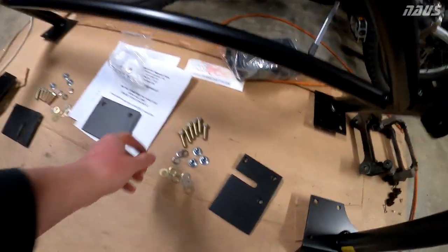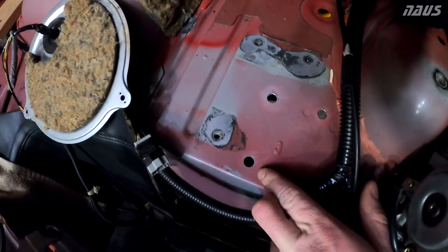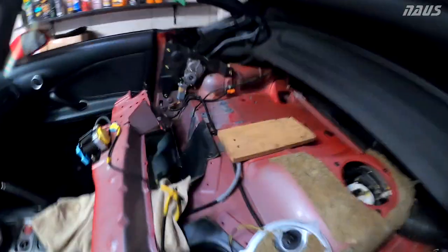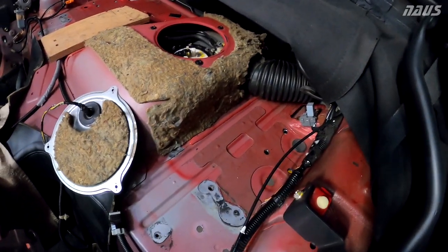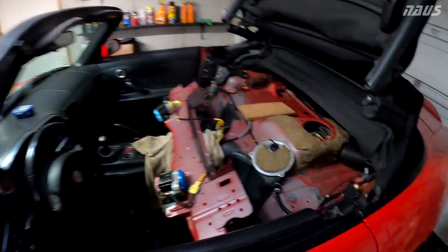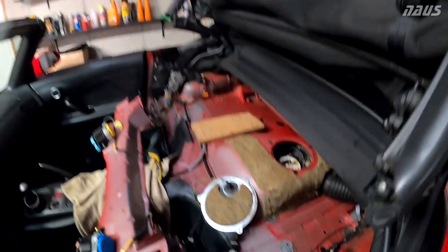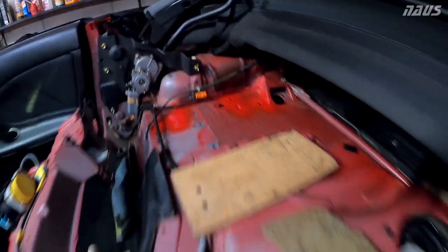For the drill diameter for the holes through the car, I want a couple standard sizes bigger than the outer diameter of the threads on the bolts they include with the Hard Dog roll bar kit. You can see there's my three holes — I took a chamfer bit to them to deburr all the edges. You can see the three back there, and the three over there, and then underneath this wiring harness there's three as well. I'm going to hit them with some red Rust-Oleum paint — just a light coat over the holes to cover the chamfer and raw steel edge. I know they're going to be sandwiched between two pieces of backing plate, but they could still potentially get water to them, so I'm going to try to eliminate as much potential for corrosion as I can. Let's hit it with some red on top of each of those, and then some flat black on the bottom.